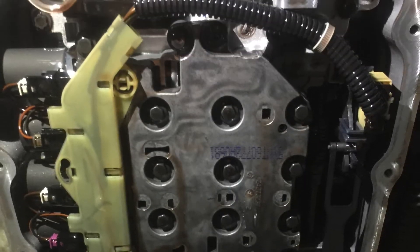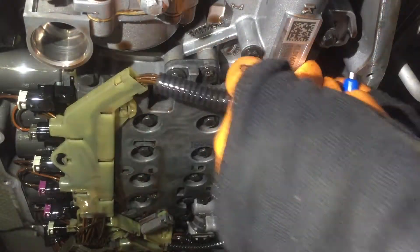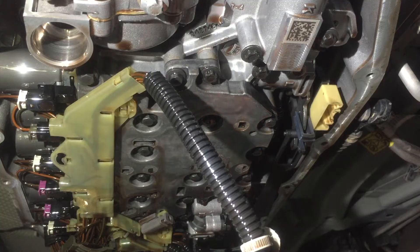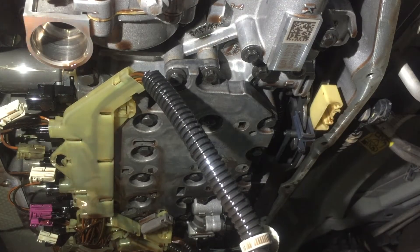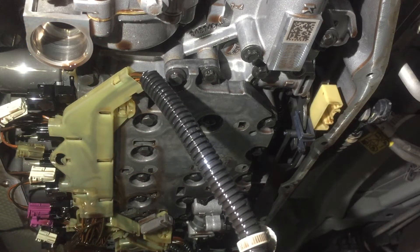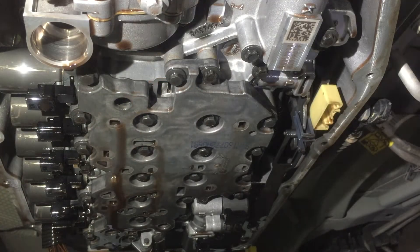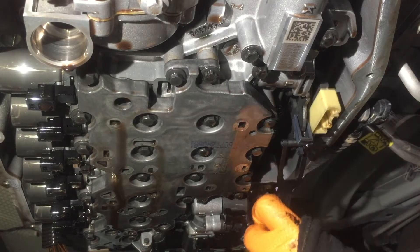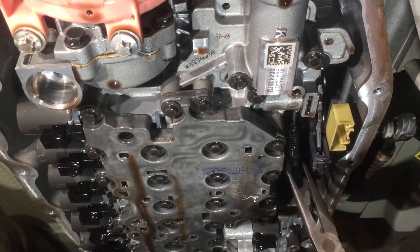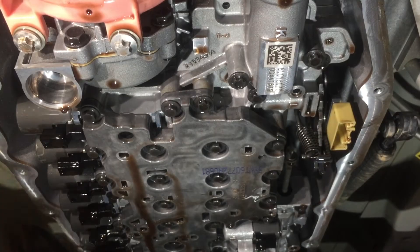Here's what the valve body looks like on the 8L90. You will have to remove the valve body to replace the transmission harness. General Motors made a change from a two-piece to a one-piece harness. Undo all the electrical connectors — they are dummy-proof; they'll only go in one way, in one place. There are three little tabs that hold the harness to the valve body — just squeeze them with needle-nose pliers and pull them out. There is one 8-millimeter bolt holding the manual detent spring. Next, disconnect the manual valve from the linkage — it's a little spring with a hook. Pull back the spring and disconnect the hook.